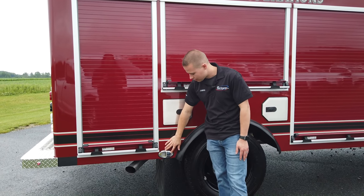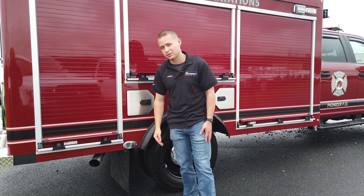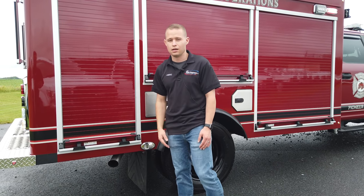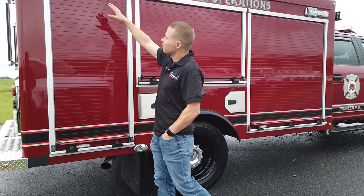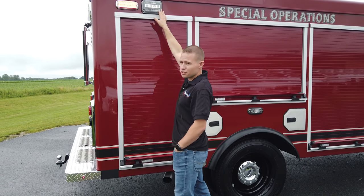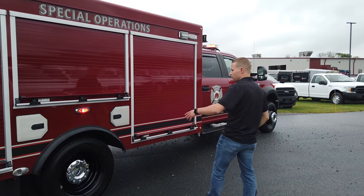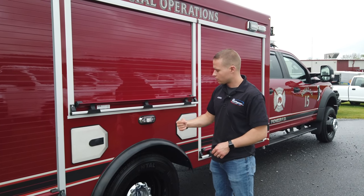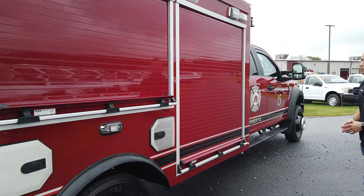This light here is called a dock light, which provides 45-degree illumination when the vehicle is in reverse, giving you clear illumination all throughout the vehicle when looking in your mirrors. We have scene lights in the back and this one off to the side. For warning and scene on the side, we have the Whelan M7 warning and the Fire Tech Junior scene light series, which is a combination spot-flood. We also have the Whelan 500V series warning, giving straight-on and angular warning so you get a nice warning sequence all throughout the vehicle.